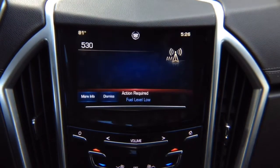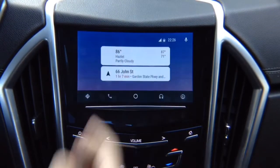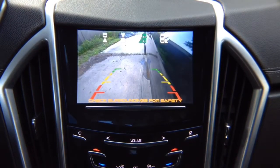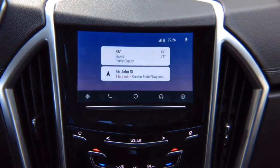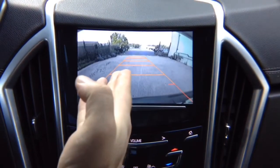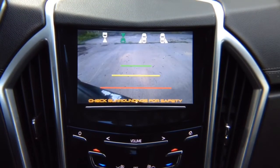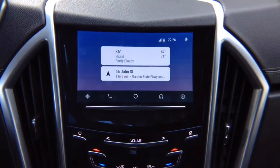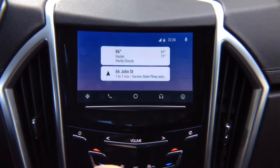Now let's say you're in interface mode using Apple CarPlay or Android Auto. Left turn signal triggers left camera and goes back automatically. Right turn signal triggers right camera and goes back automatically. In reverse, factory or aftermarket camera. In drive, front camera. Keep in mind: if you didn't add any of those cameras, it will not switch. If you're driving with the left turn signal on and didn't install a left camera, it will just continue to show factory Android Auto or Apple CarPlay.